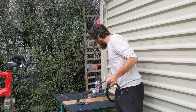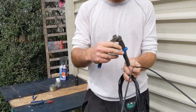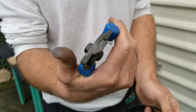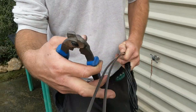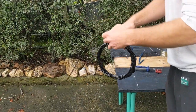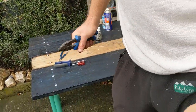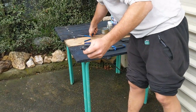So now I'm at the stage of cutting the cable sleeve. I've got these cable cutters — if you have a look in here, you can see they cut everything really straight. So you need a pair of special ones like this, not just any sort of cable cutters. You need the ones designed for this, and don't cut anything else with them because you need to keep the blade super sharp. So with this — that's the old piece, throw that on the ground — if you give it a really good hard snap like that, then you can cut a straight end.